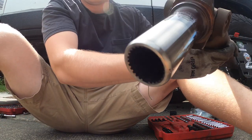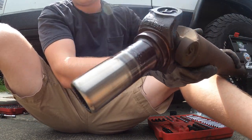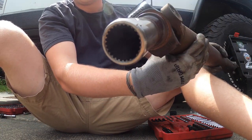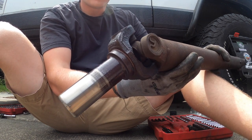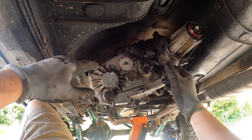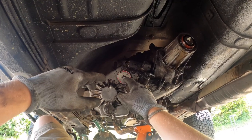This is what we're replacing — that three and a half inches of spline is all that was keeping your driveshaft actually driving your car. Now that we have our driveshafts out and the transfer case in four-wheel low, we want to start removing the things we need to remove. Because we're doing this under the vehicle, there are a lot fewer things to remove than if we were taking the whole case out.